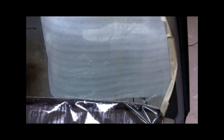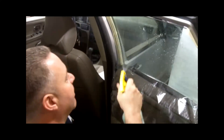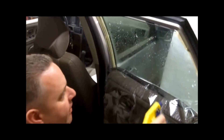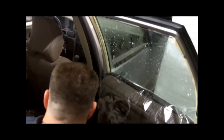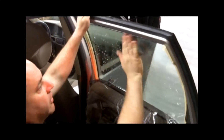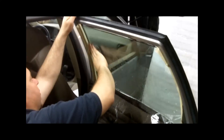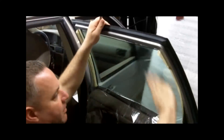I'll show you two more tricks. I've just scraped the glass and I've got most of the glue off. I'm going to wet the glass again, not really heavy, because I've got another trick. I always like to take quadruple-aught steel wool and rub it down along the edge and the top with medium force. Anything I might have missed with the blade, I'm sure to get with this.